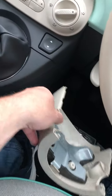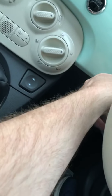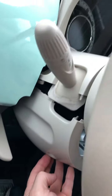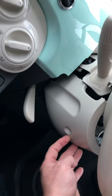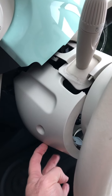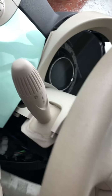This part is obviously dismantled now, but basically that goes on the bottom of the steering column. It's obviously in parts now, but effectively all you've got to do is — here and here — there are two Phillips screws which hold this bottom cowl of the steering column on. So once it's assembled, you basically undo these two screws, one here and one over here.